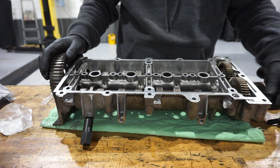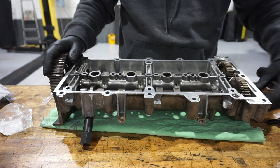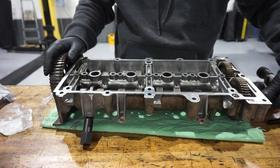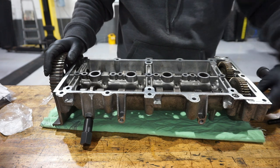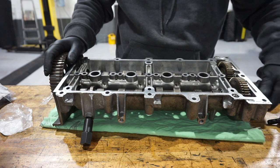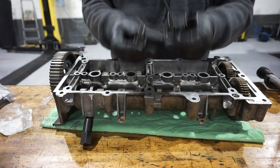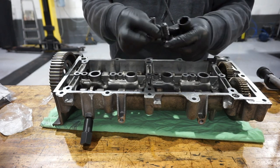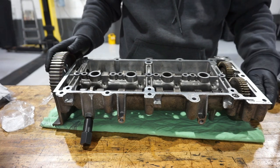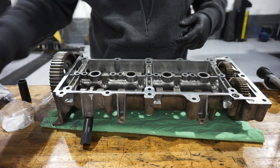The manufacturer specifies that you change a bolt. There's a reason why. It's usually because the bolts are stretch bolts, so once you've torqued them, loosened them and re-torqued them again, you're going to fatigue them. So those bolts there can go in the big box of bolts, which I call the kit car fund. So that's in finger tight now, so it's ready to place back on the top of the engine.